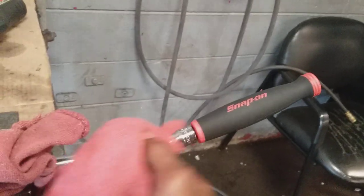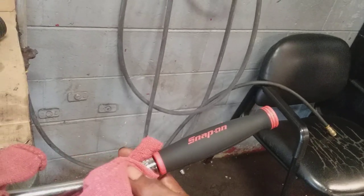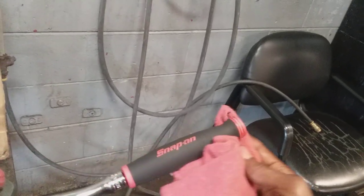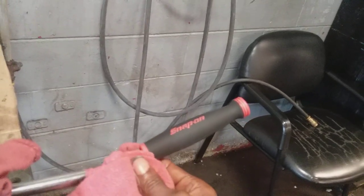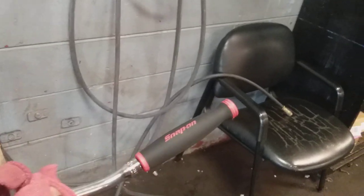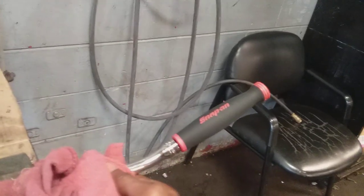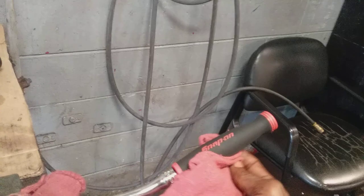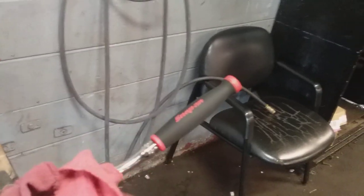The tire repair prep works best because it removes the film from sticky wheel weights when you're doing wheel balancing. I wish I could demonstrate this a little better, but I can't hold the ratchet, hold the can, and hold the camera at the same time — so I hope you get the idea from what's shown.